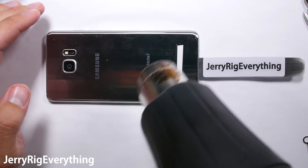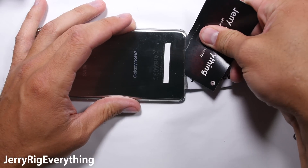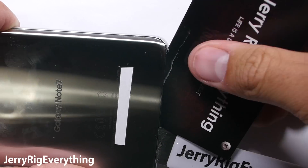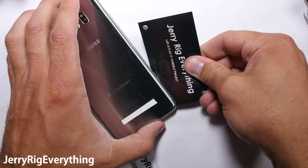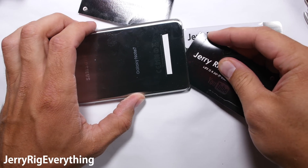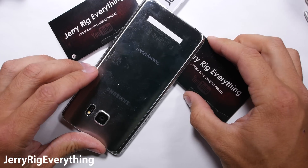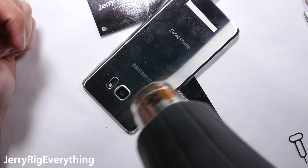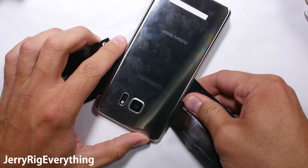Reheat the glass about every 30 seconds as you slide your tools around the edge. Before going around that back curve, switch from the metal tool to a playing card or business card, because the business card is flexible enough to wrap around that curve without putting extra stress on the glass. After about 30 seconds, heat up the phone again and slide a second card around the second curve, slicing through the adhesive all the way around. Don't go too deep inside the phone, as there is a wireless charger, NFC pad, and a ribbon cable next to the power button.